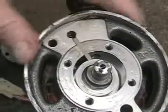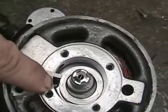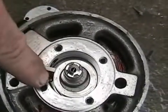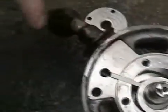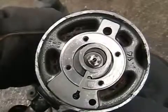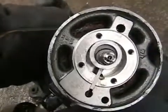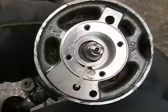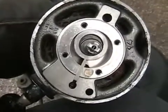That's the intake. The exhaust is that other little hole there, which has a one-way valve on it, so freon can pass in that direction but not come back. This side has no valve that connects to there. So when you rotate this, that vane almost acts like a piston ring, always keeping pressure against the side of that rotating cylinder, sealing everything.